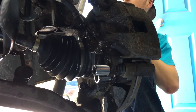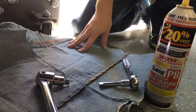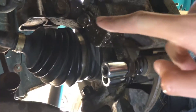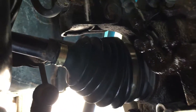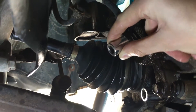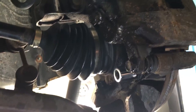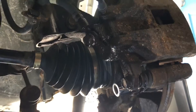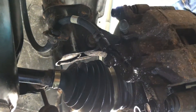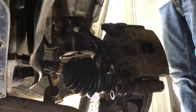The sizes are probably different on a different vehicle, but this should be about the same procedure for most vehicles. Remove those bolts — you'll probably need a big breaker bar and a ratchet to finish it off. Before you break those loose, you're going to want to remove your brake line, which on this car is a 15mm. Make sure you keep your brake cap on so you don't have gravity bleed, and try not to get brake fluid everywhere because it'll stain everything.